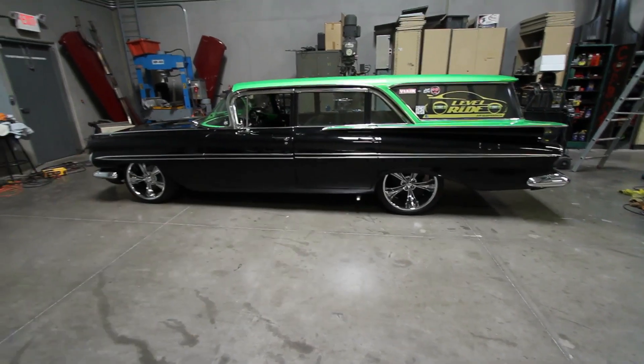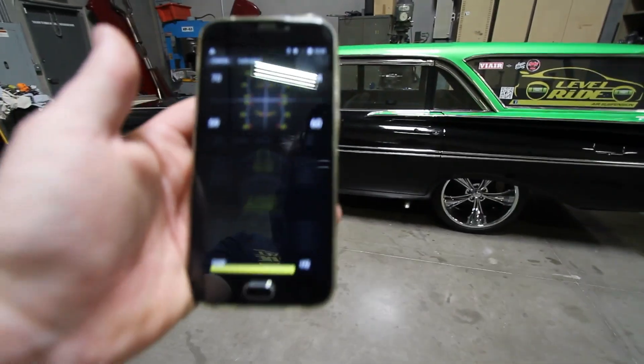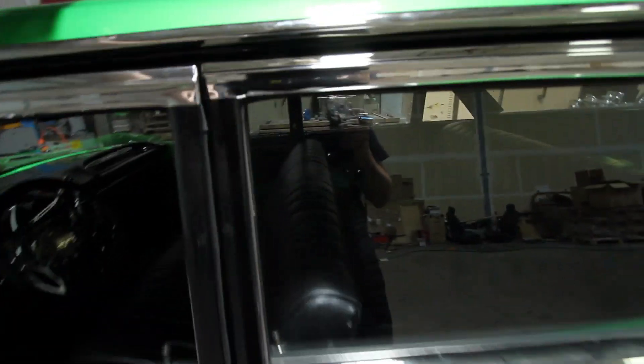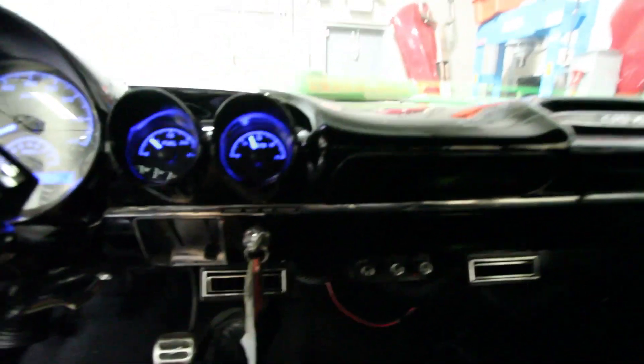After it's aired out, it'll take 10 to 15 seconds and then it will come back up to around 40%. The compressors will come back on. We've currently dropped to about 172 PSI. This car is running two four-gallon tanks, so we have eight gallons of air running at 200 PSI.